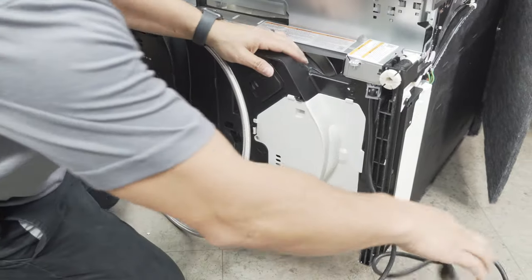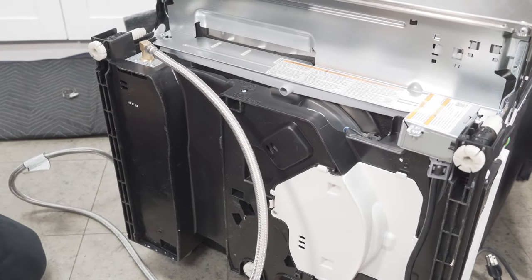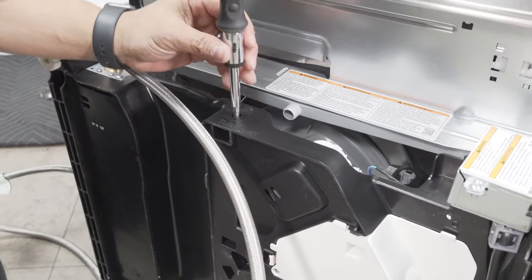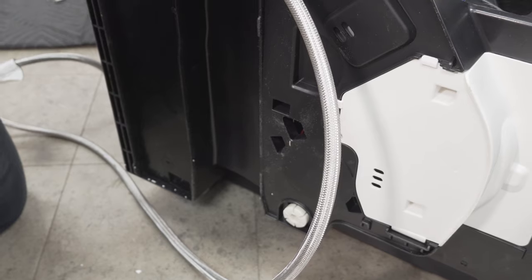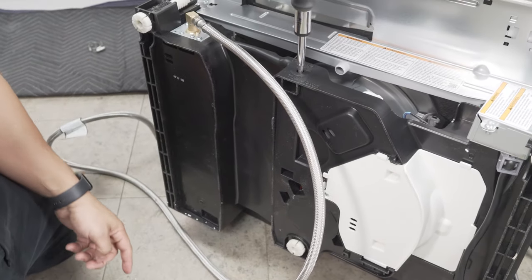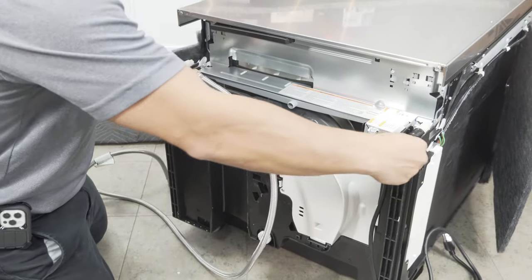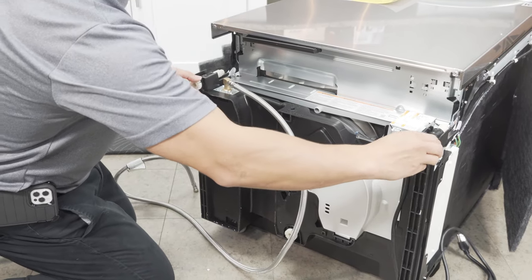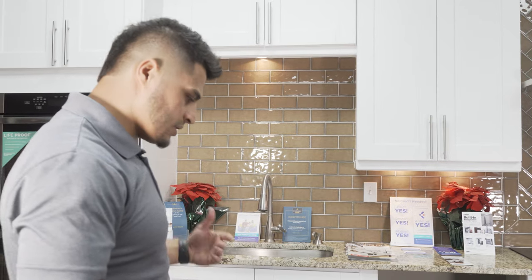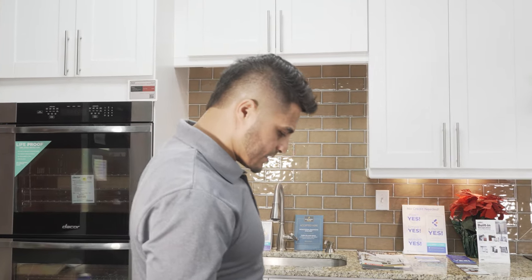Our electric is out of the way — the dishwasher is ready to be plugged in. Our water line is already attached and ready as well. I'll just give the rear leveling screw a slight start to make sure that mechanism is functioning properly, and do the same with the front feet — just a slight turn to get them ready, since sometimes they come overly tightened. Water line connected, electric line installed, drain line is factory installed. We can now get this on its feet and prepare to slide it into the space.